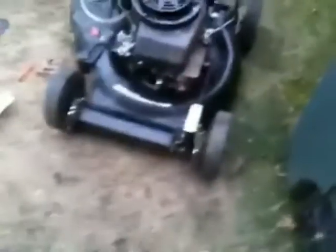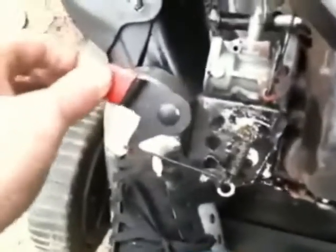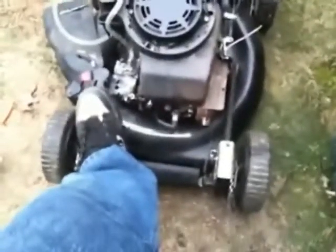It has this little thing that comes out of the block and drives the gears up front — those slip, probably because I got oil on them. But that needs to be looked at. It runs fine on the low setting, but as soon as you turn it up — this little knob, when it's forward it's lower, when it's back it's higher — every time it goes back it just starts hunting and surging.